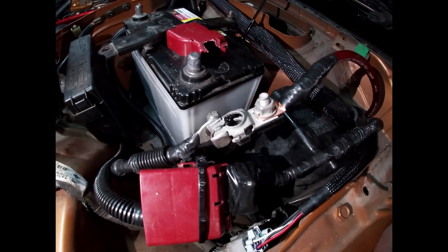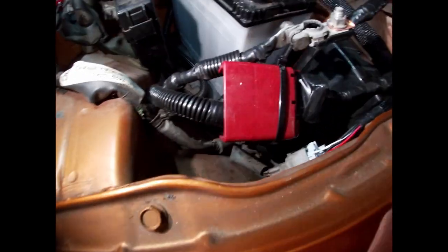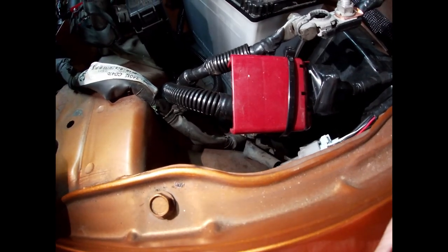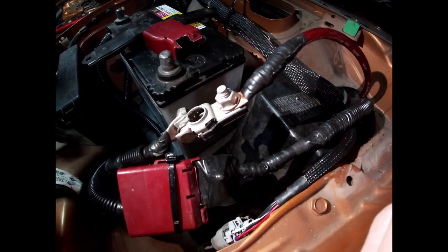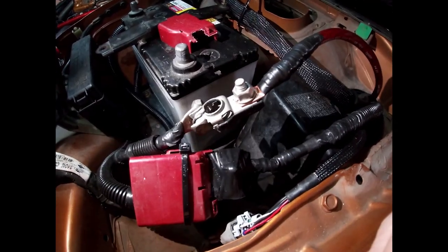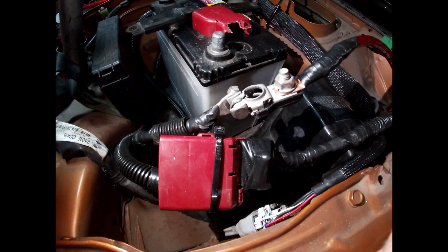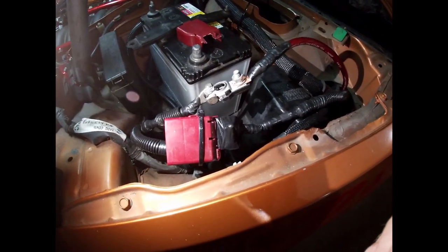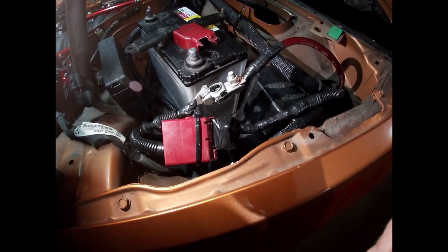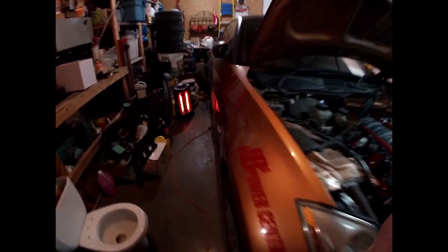The factory terminal disconnects from a little plate here that has three bolts sticking out of it — one can run the alternator and one can run the starter. I had a cable attached to it so it could connect to the battery. I took that off, ran my battery wire inside, and now have the alternator wire hooked up to this terminal. I tried it out and it works — kills the power. One side runs to the wiring to power up the whole car and the other side is alternator and battery. The 12-volt wizard I talked to confirmed it'll work.